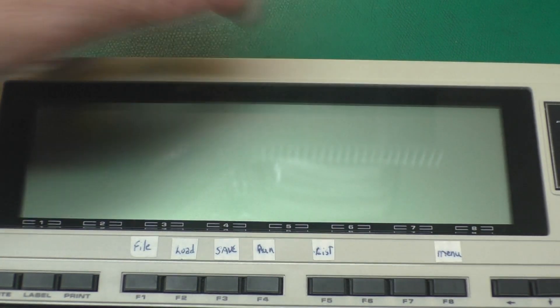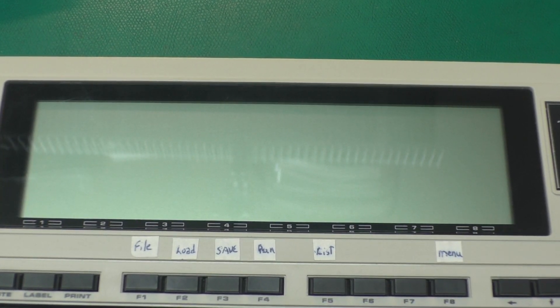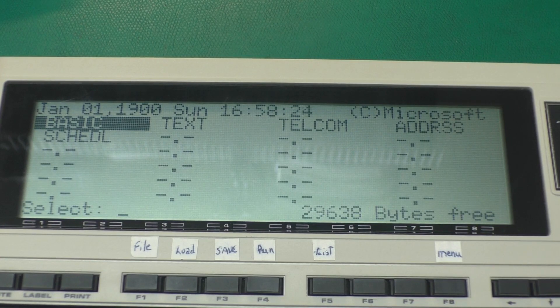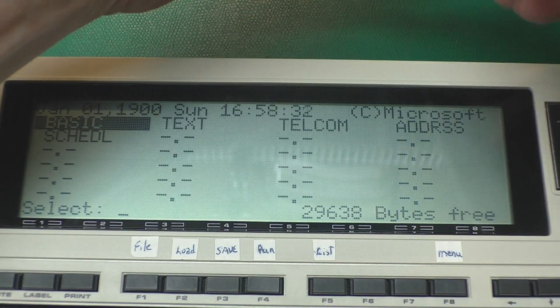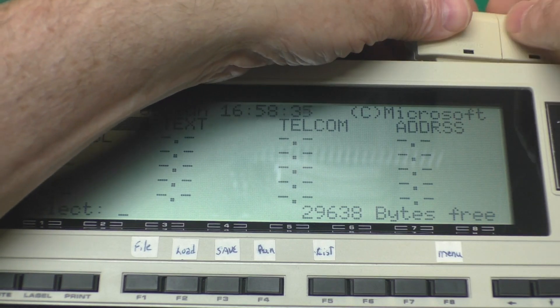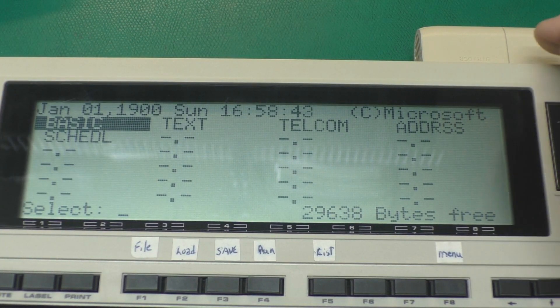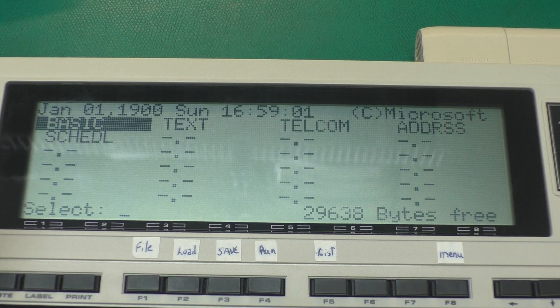It's always a challenge to get a good shot on video of these old LCD screens and not get a lot of reflections, but hopefully this will work out well. So I've got my Tandy 102 set out here, and I'll go ahead and turn it on — and you notice this is just bone stock, it has nothing installed on it. I've got my drive turned off, the switch is up away from the dot. If we don't have TS-DOS already installed, we can bootstrap TS-DOS into RAM. So what we'd want to do is go into BASIC and type: run com 98n1enn.